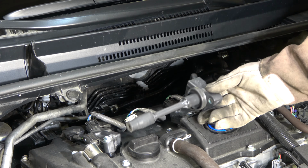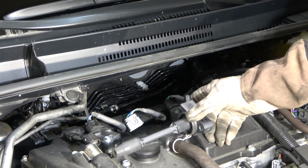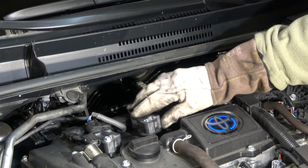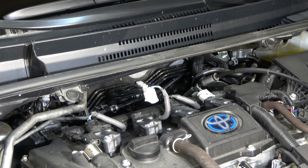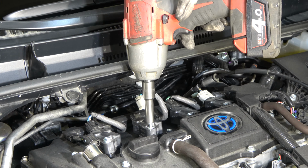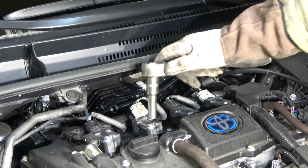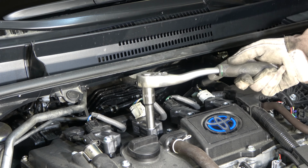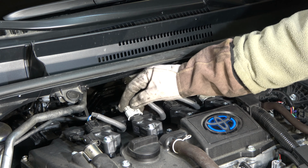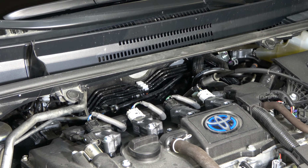And then I can install my ignition coil back. And this ignition coil installation back, this goes nicely in that place. And then I press that down. And there is this locking bolt, which goes nicely. And I can use my hand or electric driver. And then I tighten this bolt with about 20 Newton meters force. 10 to 20. Now it's well, excellent. And the final part is to install this ignition coil connector back and listen to the sound in that way. Good. And we can listen to that connector sound again.